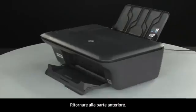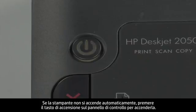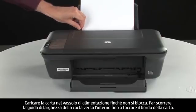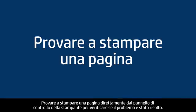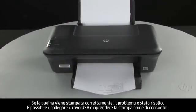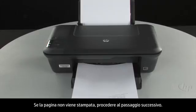Move back to the front. If the printer does not automatically turn on, press the power button on the control panel. Load paper into the input tray until it stops. Slide the paper width guide inward until it stops at the edge of the paper — do not push it so tightly that it bends the paper. Try printing a page from the printer's control panel. Press and hold the black and color copy buttons, then release both at the same time. If the page prints successfully, the issue is resolved and you can reconnect the USB cable. If the page does not print, go on to the next step.